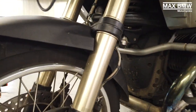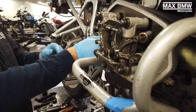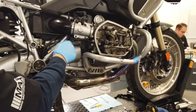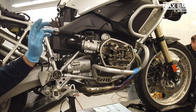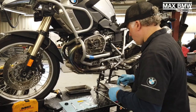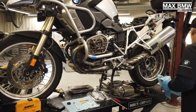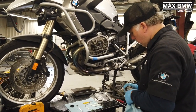At this point, you're going to come around to the other side of the bike and remove the top dead center tool — you don't want to forget that in there. You're going to turn the motor over and repeat the process, but this time on the right side. We're going to be using new gaskets. Now comes the fun part — some cleaning.